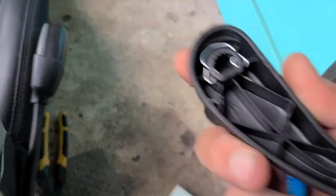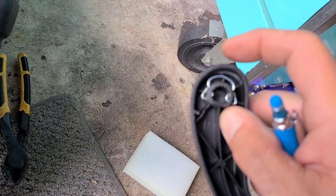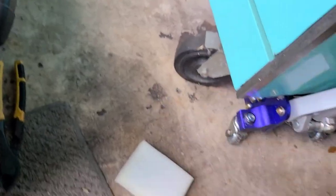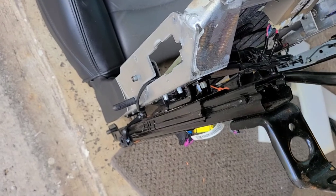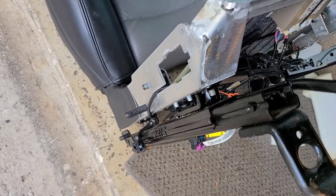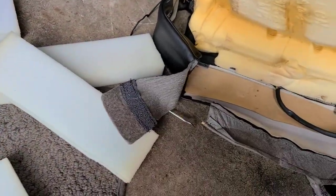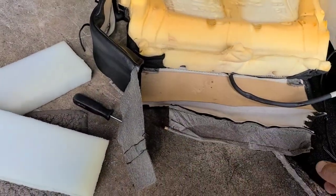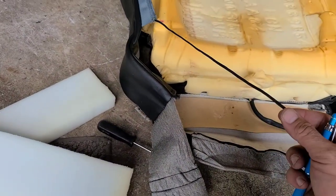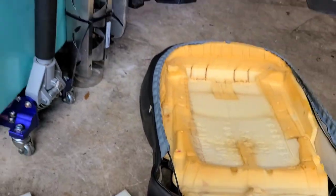The only other thing you have to do is see this little clip — you either push it down or pull it up. In my case it was upside down, so I actually had to pull it completely out. Then it slides off its support, off its shaft. Once you do that, you get the three hog rings — unplug the seat heater. There are two corner hog rings, and under the Velcro you'll see on these little tabs there's one other hog ring, so there'll be a total of five. And then here's the string that you will not cut — you will untie it. Then you can take the seat bottom off.